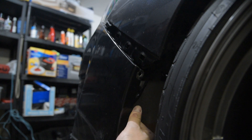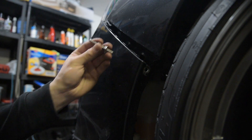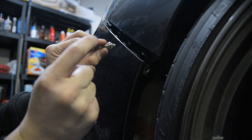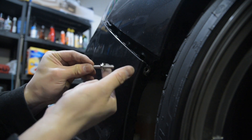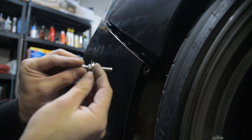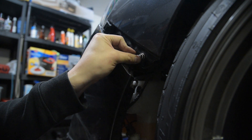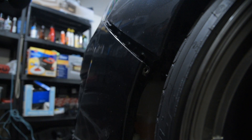I think that's the whole point of this. From here, we have the stud itself, then you get two washers and also two nuts. So this has to stick out this side, and then the nut threads in first — put it all the way over. Then this washer goes out here, and then you would stick it through here. This is what holds it in, and you can take the other side and thread in the other nut. Very easy to install this stud. I just wish I could give you guys a better angle, but that's all I got right now.